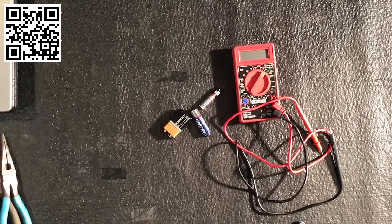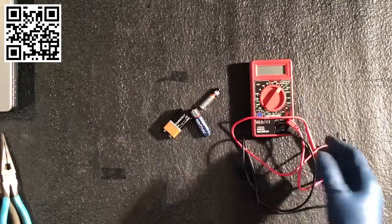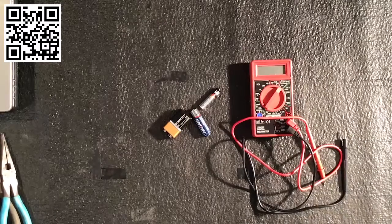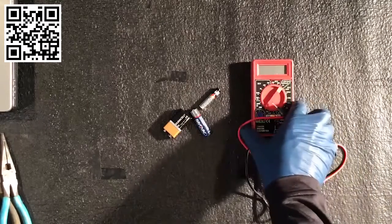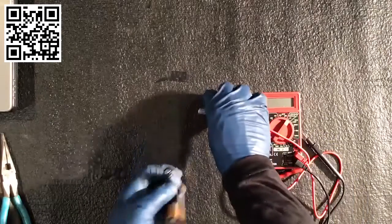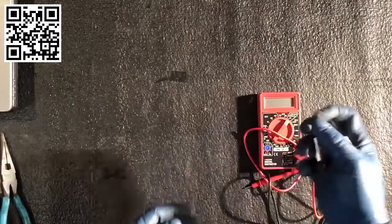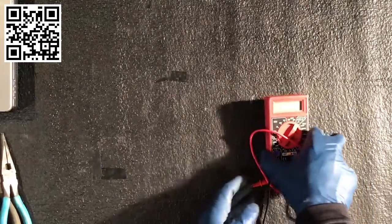So don't forget things like your ESD strap and your PPE as well, because I consider those tools. I always keep my multimeter in with me. I sometimes take two or three different ones as far as brand and manufacturer and capability. We discussed these in our safety chapter somewhat and in our voltage chapter. I keep some batteries handy as far as AAA and double A's and some 9-volt batteries, because you're no good out in the field if you don't have a meter to tell you whether electricity is working or not.